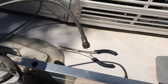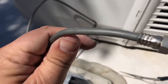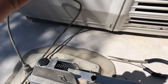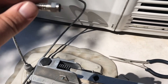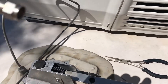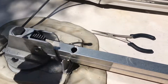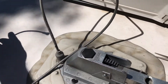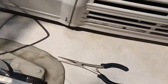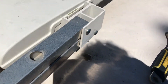Once you've pulled the cable out of the tube, you can just pop the grommet off the end. The kit comes with new ones. When you go to put the cable back through, you're going to want to route those grommets — stick them over the core of the cable first — otherwise you're not going to be able to get them on after. Sounds simple but it's the kind of thing I'd forget. The next part is to remove the antenna head.